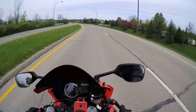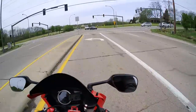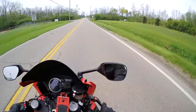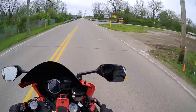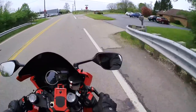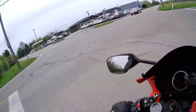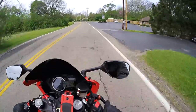Accelerates too quickly. So right now, I'm in position number one, which is pump gas. If we change it over to position number two, what happens? We've got pump gas in the bike. Basically nothing. There's only a slight difference in mapping. It's not enough to be dramatic, but it will hurt your fuel mileage and the bike will start to gargle. You can hear it there, womp, womp, womp. It's best to run the pump gas map with pump gas. And if you're going to put some MR12 in, Savage Mode is on position number two.